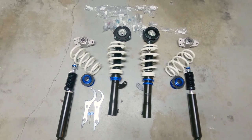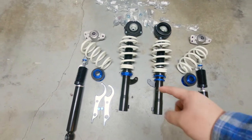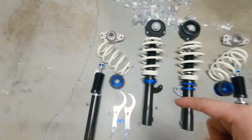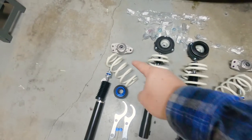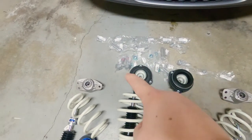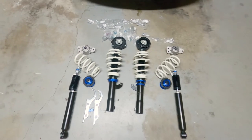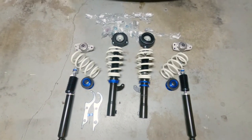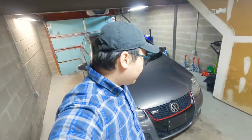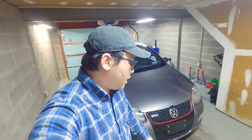So these are all the parts I'm going to be installing or replacing. These are obviously the suspensions — this set is from Raceland, it's the one with adjustable dampers that you can adjust at the top. I also got upper mounts for both front and back from Raceland as well, and I also got some spare nuts and bolts from ECS Tuning, just because the car probably hasn't had the suspension stuff replaced for 11 years. So I thought it'd be a good time to swap those nuts and bolts as well. I'm pretty excited — as I mentioned, the rear suspension is actually cracked, that's why the rear is a little bit lower than the front. And I've been hearing some weird clunking noises as well, so it's definitely the time to do this job.